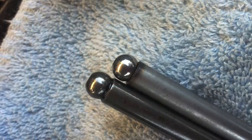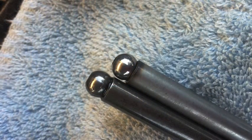Alright, back to Project Nickel and Dime. I went ahead and ordered up some new push rods from Ford Racing. They are 6.272, and the ones I was using were Comp Cams. It was a 6.4, so basically I was bottoming out the lifter, and I wasn't getting full retention, bolt down torque on the pedestal mount rocker arm, and basically the geometry, all that was left of the resistance was to push down on the valve.